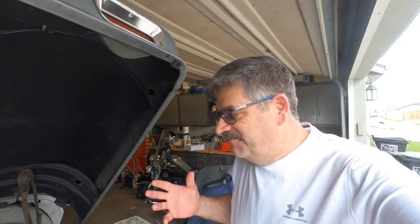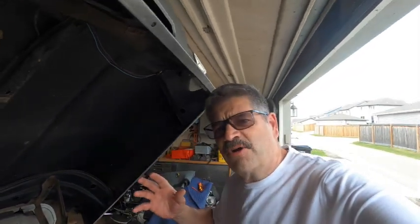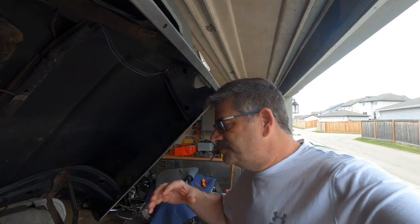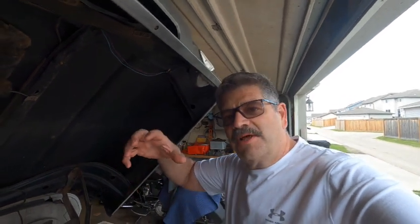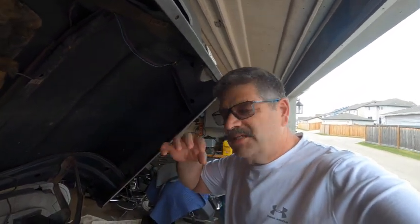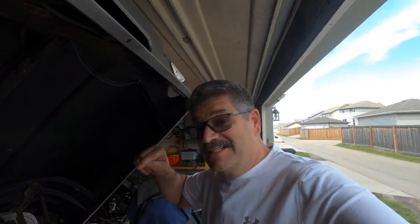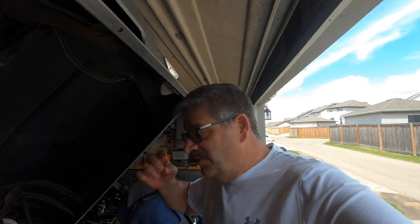Okay, as is seen in the video, she fell flat on her face. In fact, it stalled. I brought it back home and adjusted the timing a little bit. It was just a little too far advanced. That's the first time I threw Pertronix on and had to adjust the timing, but it is a thing. You do have to do it sometimes. It can be out as much as 10 degrees. And in this case, I think it was out every bit as much as 10 degrees. So keep that in mind.